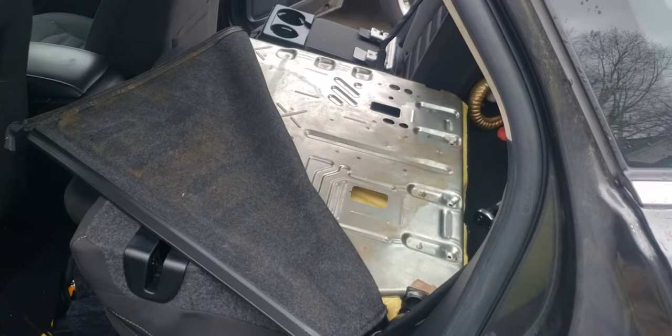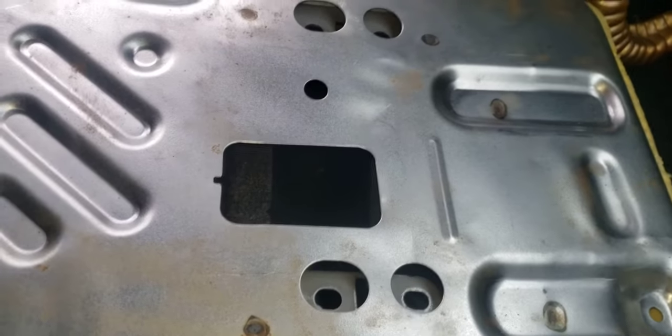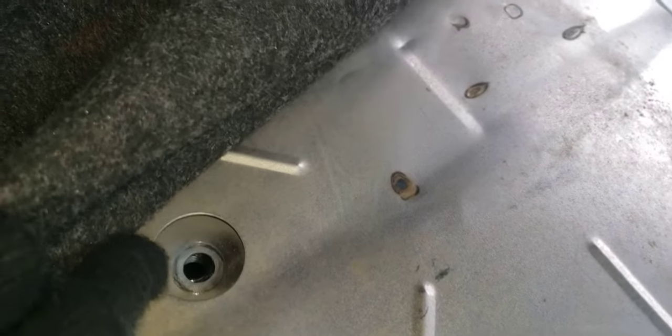This is what I was talking about for taking it apart — it's got a lip with the other side tucked on the inside of the seat. You squeeze those two together, then separate and pull it apart. Like I said, you'll have a zipper over here — it starts about here and you unzip it all the way up to this corner. That gives you enough room to get to the armrest bolts — one over here and one over here. Then when you pull this back you'll have your T50 right there.